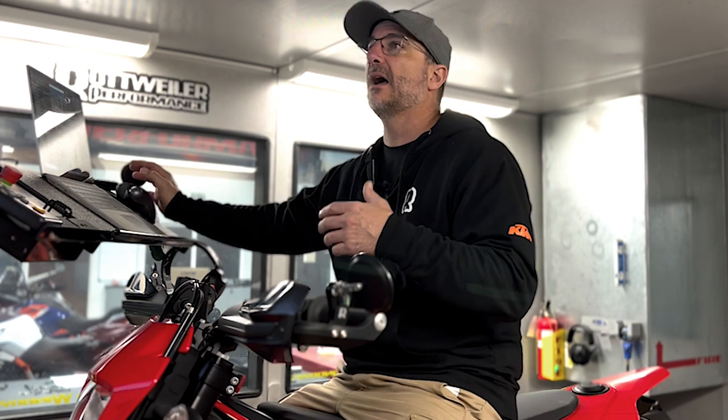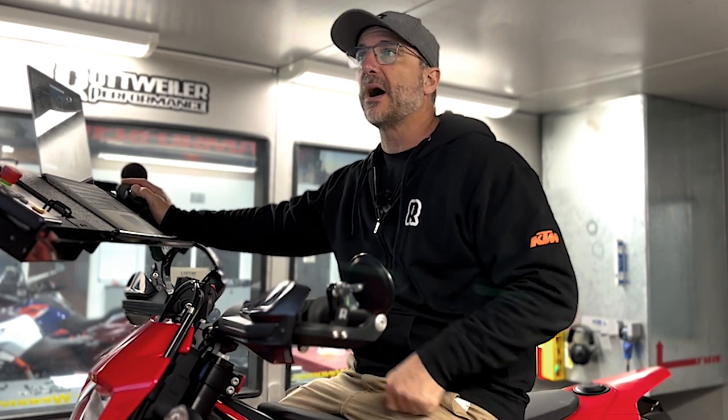So what we found, and we're going to show you on the screen, is that you can run a Rottweiler intake system, but it does lean it out in some spots, not dangerously so, but enough to where you're probably going to want to put on a Power Commander 6. I'm not trying to sell you on one, but that's the point of this video.